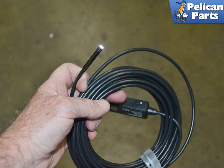You can buy a bore scope that will work with your phone or computer. Make sure you get one that has lights on the end — a 45 degree mirror attachment is very handy. You will need to get each cylinder to the bottom of its stroke to allow you to see as much of the cylinder wall as possible. You are not timing cams here, so all you have to do is rotate the engine until the piston goes to the bottom of the cylinder.